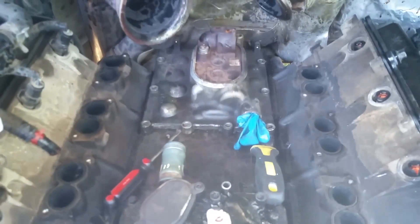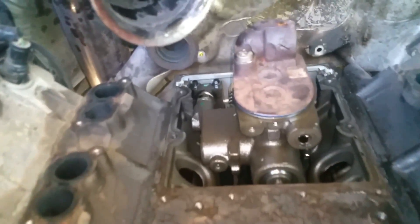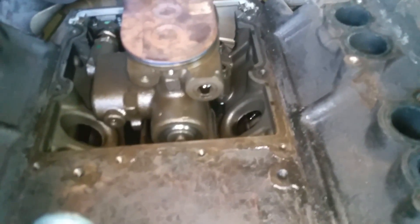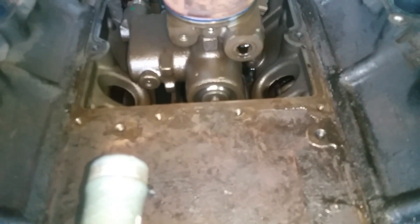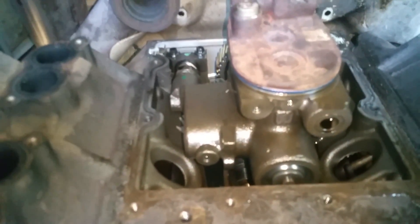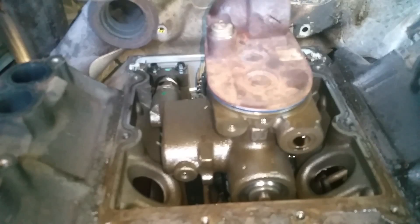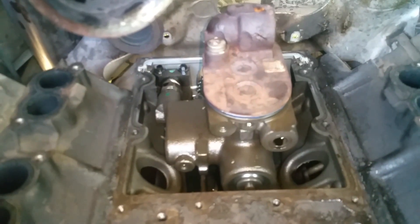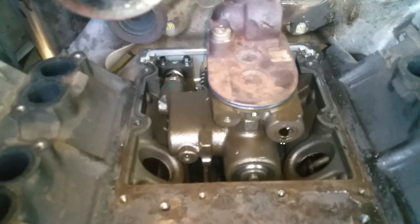We finished working it up and out of there. Here it is with the front cover off. I want to point out that I did clean this surface and covered my intake — I vacuumed and blew this out really well just to minimize any debris getting in there before I took this cover off. I've already found several problems and I just don't know that there's going to be any hope for this engine because of the melting, but I'm just going to keep looking around and inspecting.